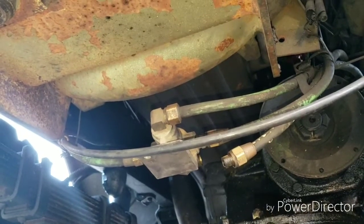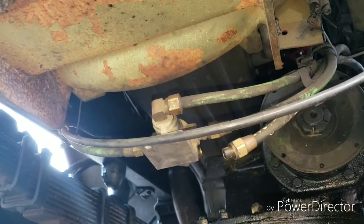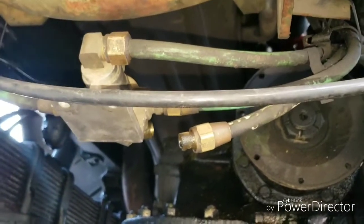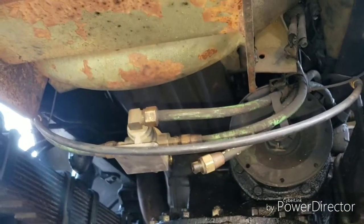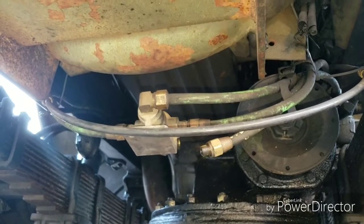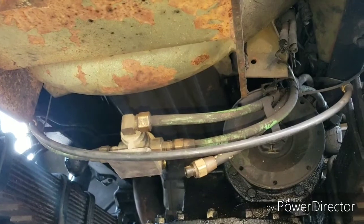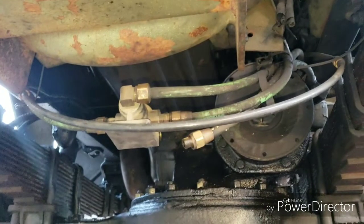When working properly, it shouldn't hiss air until it releases — that's the little sound you normally hear when you release your brakes. So one quick way to determine the Q2 valve: pull that vent line off. If the air going to your intake stops immediately, you know it's the Q2 valve. If it doesn't stop, then you've got a service brake diaphragm that's leaking across — and it can leak a lot, especially if there's a hole right through it.